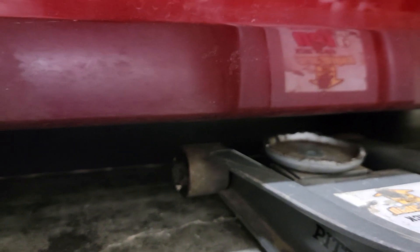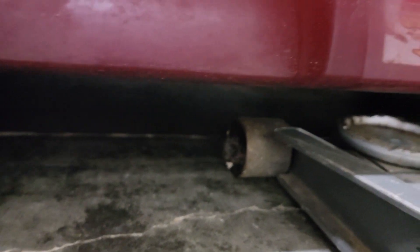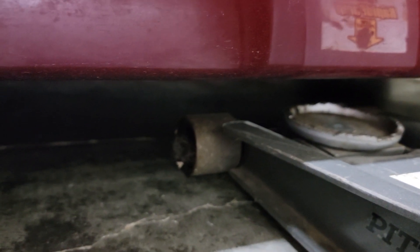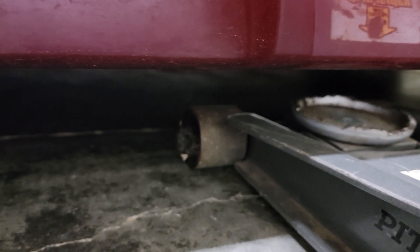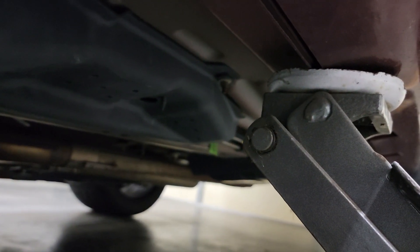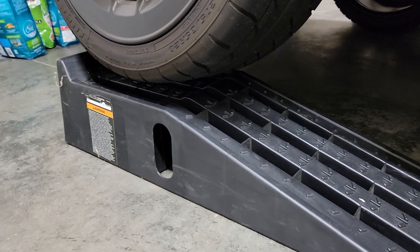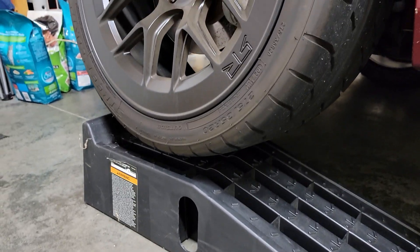We are going to go ahead and get the car jacked up. Under here it's hard to get to, but there is a metal spot under the plastic off to the end. What you want to do is get your jack cup to hit that in the center. Once I get the car up a little bit I'll show you what I'm talking about. You have that metal strip that goes across the center right there — that's what you want the jack to be on. If you're using jack stands, you'll see these little arrows — that's where you would put your jacks, one here and one in the rear. Then I went ahead and slid the ramp under it, aligned it up, and lowered it on there.